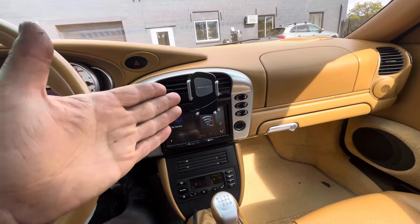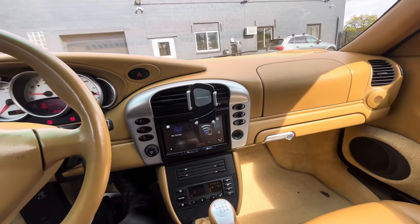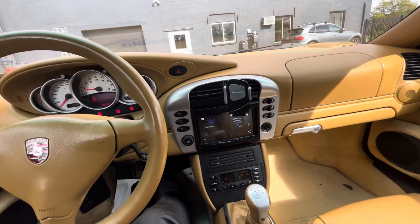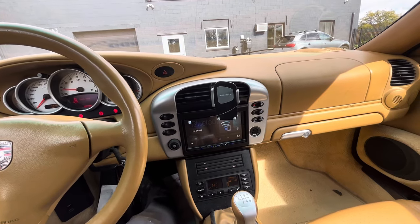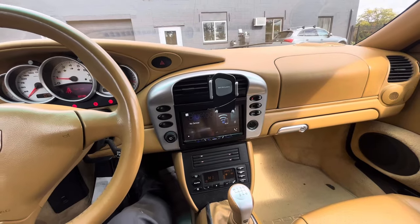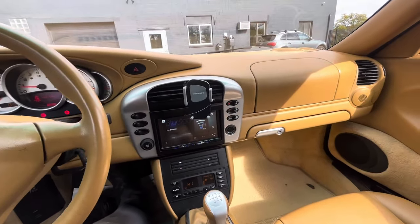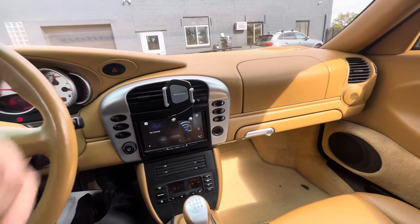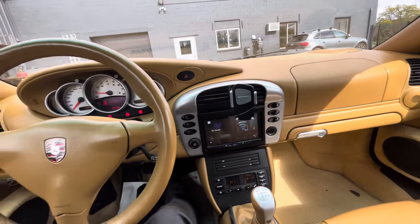It's usually pretty harmless, but you'll start to notice a little bit of a reduction in performance with your heat and AC. A lot of times when your blend door starts falling apart, it can't regulate the temperature quite as well at the maximum — so if you have full heat on or full AC on, some heat may be leaking through when it's supposed to be only AC, and vice versa.